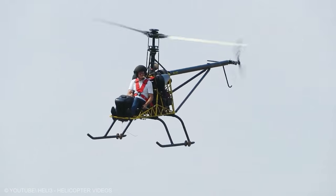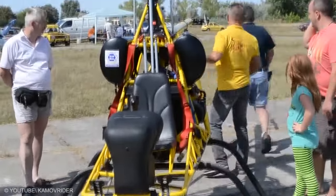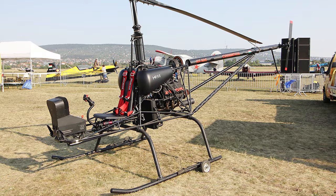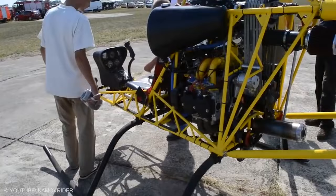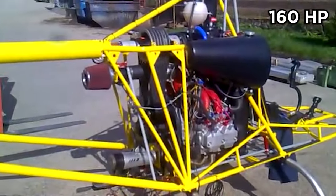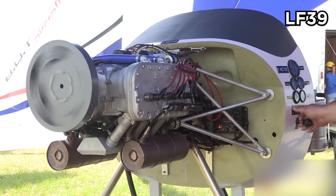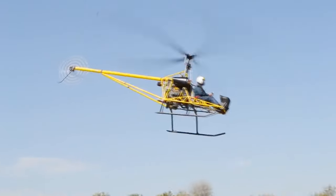The Hungarocopter is a Hungarian helicopter produced by Hungarocopter Ltd., designed to comply with European Microlight aircraft rules. It features a single main rotor and tail rotor, a single-seat enclosed cockpit with fairing or an open cockpit without a windshield, skid landing gear, and a four-cylinder four-stroke 135-horsepower Subaru EJ22 or 160-horsepower Subaru EJ25 automotive conversion engine. The six-cylinder 125 HP D-Motor LF39 powerplant has also been used. Construction time from the supplied kit is estimated at 300 hours.